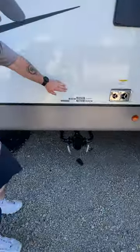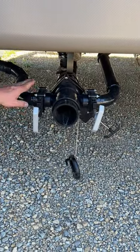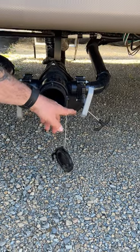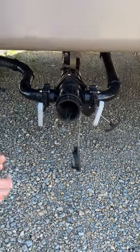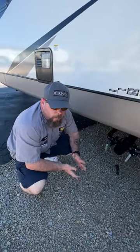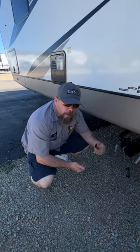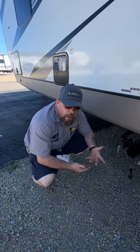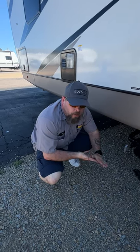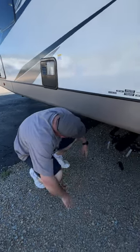Next, we're going to have our drain outlets here. You've got two gray handles for the gray tanks — one is the bathroom sink and shower, the other is just your kitchen sink. Then you've got the bigger one with a black handle for the black tank. One important thing to note: never leave the black tank valve open. Most people staying a while will just leave the sewer hose hooked up and leave that valve open — you do not want to do that. You've got to have some liquid in the bottom of that tank, or your waste is going to get stuck to the bottom and start forming a buildup.